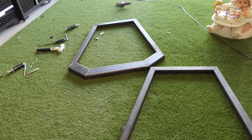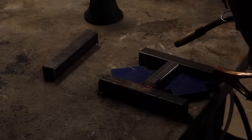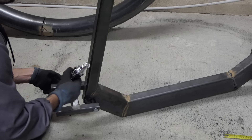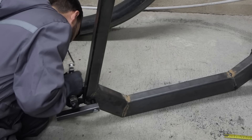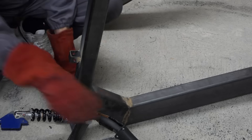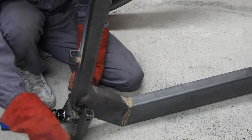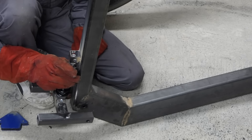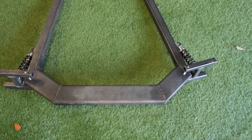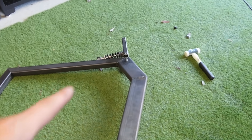We have two inner frames and a helper. What's dad making? A tank. Now I wanted the diwheel to have suspension for a few reasons — the main one being it allows for adjustments for any mishaps along the way. So I made these H brackets which allowed the suspension to be connected to the top, then welded on a little box section as the connecting point between the suspension and the frame itself. It's a bit worrying thinking that all the weight is going to go through this joint and this bolt through the middle.